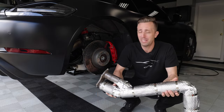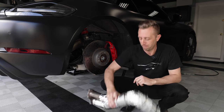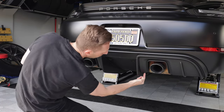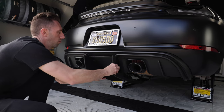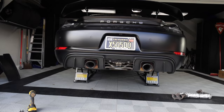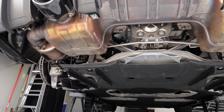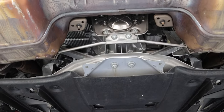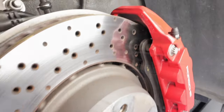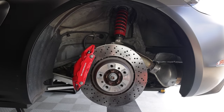It's been a few weeks, but it's time to install these over axle pipes. I'll start by showing you all the attachment points. To see everything more clearly, including the muffler attachment points, we're going to remove the center diffuser section, which is held on by six T25 Torx screws. Underneath: over on the left is the first GPF, and there are five bolts holding it to the muffler on that end. Over on the right, same thing — five bolts to the muffler. In the center, the muffler is mounted to the car with only four bolts. Over at the other end of the axle pipes, you've got three studs and nuts holding the pipes to the catalytic converters on each side.